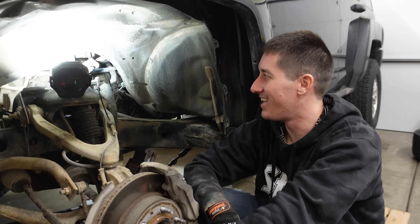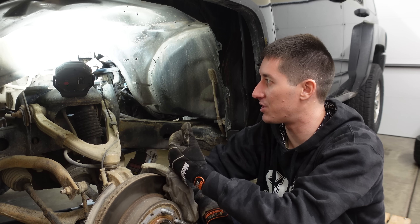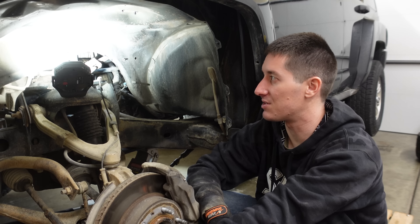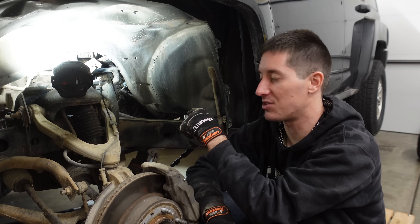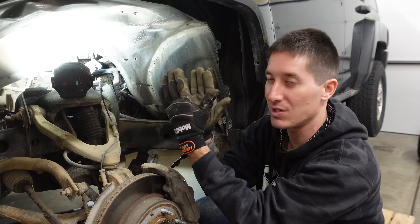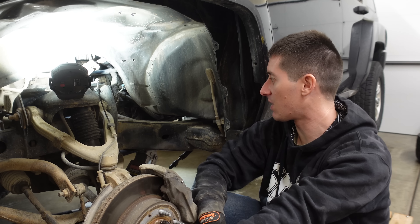The starter won't come out either. I've almost got it out — there's like one bolt holding it in — but the suction line for the AC compressor is in the way, so you can't actually work the starter out of there. What everybody apparently does is pull the actual intake off the side of the engine, which looks impossible — that's like a five-hour job. So we're leaving the intake alone and going back to the transmission. What we're going to try now is the 'wrong' way: pulling the bell housing bolts, sliding the transmission off the converter, which opens up the inspection slot so we can get a wrench in and get the converter off.